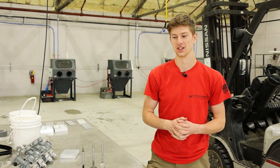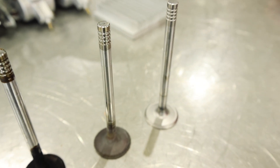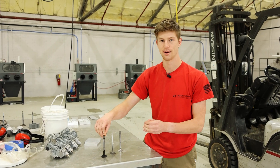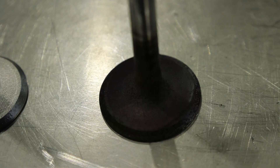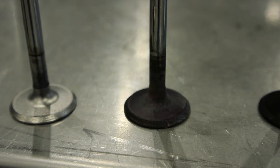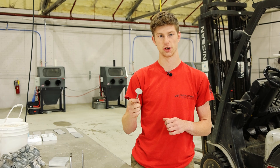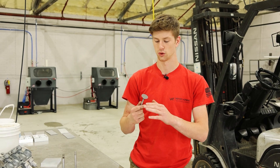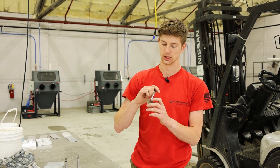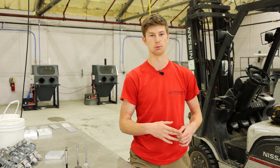Here's a good demonstration of the three different levels of cleaning power: hydro blasting, dry soda blasting, and wet glass beading. Hydro blasting has no aggregate — only high pressure water — so it struggled quite a bit with removing the carbon buildup. The dry soda blasting impressed me; typically non-aggressive, but it was capable of removing quite a bit of the carbon. And here on the end, wet glass bead did a phenomenal job bringing this back to a polished finish. Glass bead is a circular abrasive — not designed to cut, but it doesn't break down like soda does, so it scrubs continuously as it's carried across the part through the water, leaving a nice polished finish with no carbon buildup.